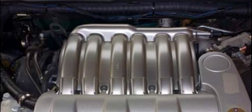So in that case, if you made that mistake after washing your engine and let water enter there, you will be forced to remove everything, remove the intake manifold, and find a way to suck out that water. In fact, you will even be forced to remove the spark plug, and some of the water will flow into the combustion chambers directly on top of the piston.